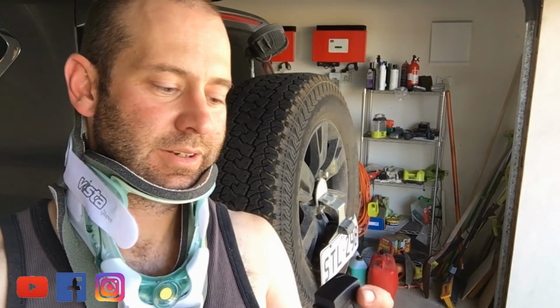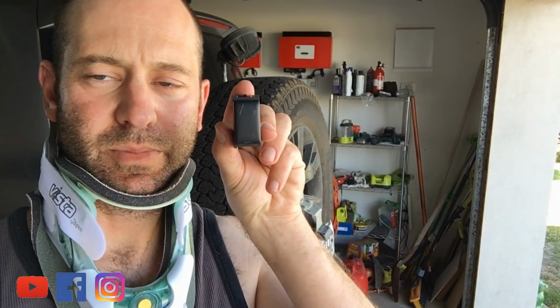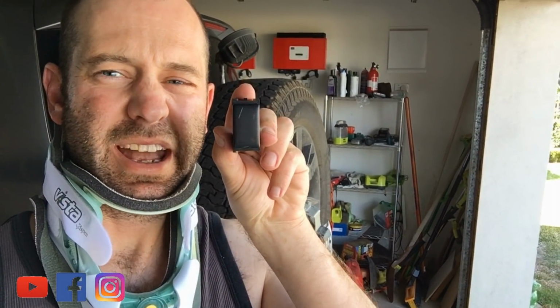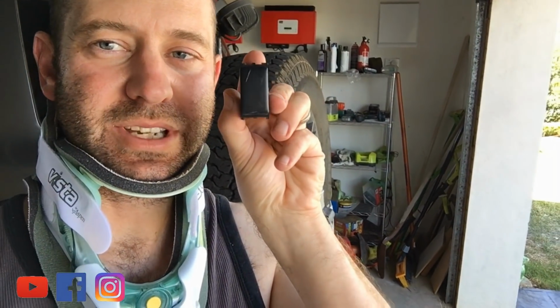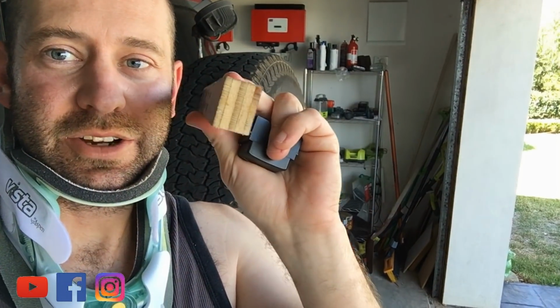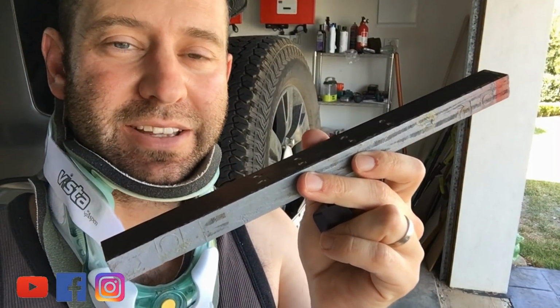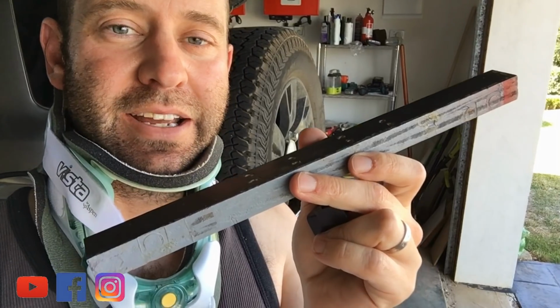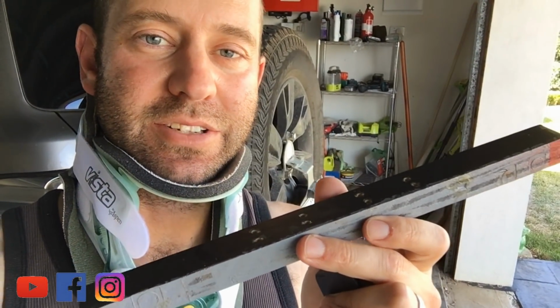One last thing. The little switch thing that you want to get out of the dash to put your remote sender unit in, how do you get them out? They're a pain in the ass. You can fiddle around for hours to get this out. I'll tell you the way to do it, get a bit of wood, sit it over the edge, and whack it with a hammer as hard as you can. It will smack that little bugger out in 3 seconds flat, and you'll save yourself hours, and it doesn't damage it. And you're gonna drill it out anyway, so just do it.